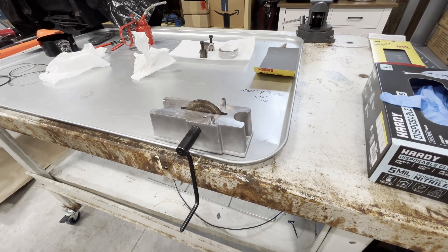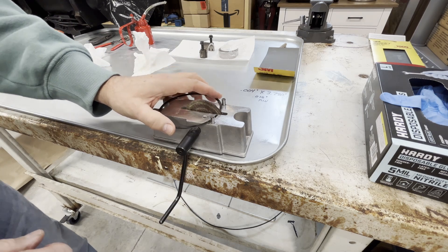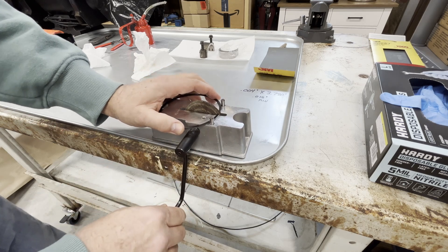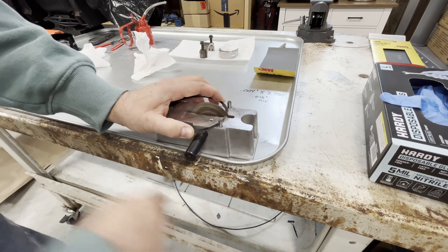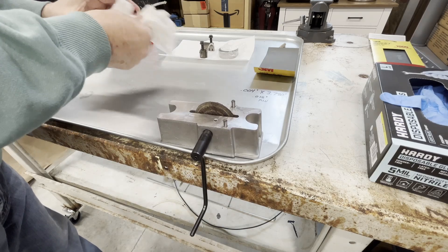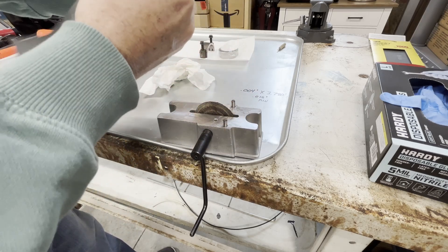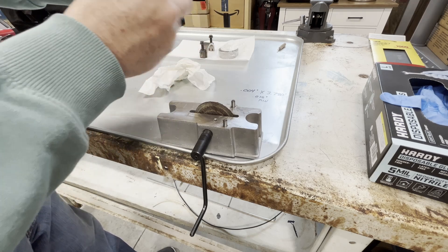I know for a fact I'm going to have to adjust the gap on the top ring — I've had to do every one of them. So basically you're going to take your ring and your ring grinder and squeeze that together. In addition, I've been taking some thousand-grit just to knock the burr, just in case there's a little burr on the edges. Just knock those down.